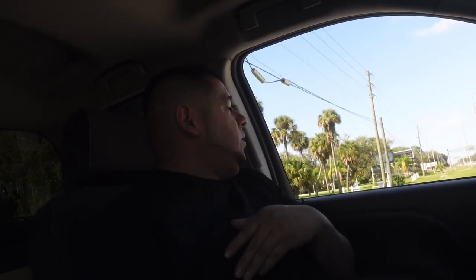We're back in the Silverado — I gotta go run a mission. By the time I get back the door panels should be somewhat dry, but I'm going to let them sit overnight so they can mold really good. Tomorrow I'll drop a quick video cutting them out and laying some rings so you can get a better idea of how they're going to work. We'll have to chop some corners to get them to fit, then put a step router round-over on them so we can staple the fleece. After resinating the fleece stage we'll fill it in with some filler and give it nice curves so it looks like it was meant to be there.